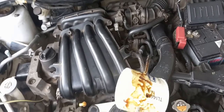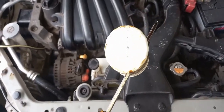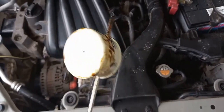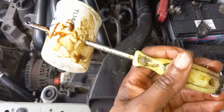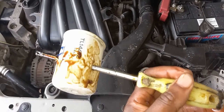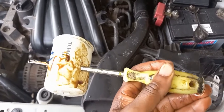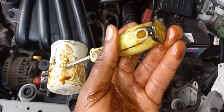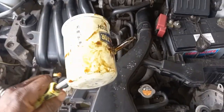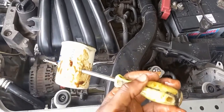So this is what I would have done. To remove the oil filter you can purchase or use a wrench. I don't have a wrench, so what I would have done is just bore the filter with this screwdriver. I'm gonna need a screwdriver and a hammer to actually hit it. Once you bore it, you go anti-clockwise like that — don't go clockwise. Rotate anti-clockwise and that is how you actually get it off the engine.